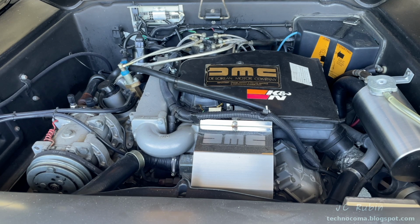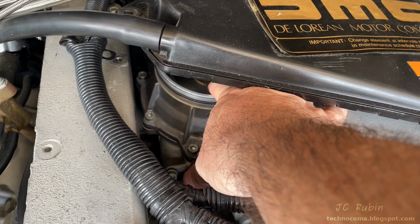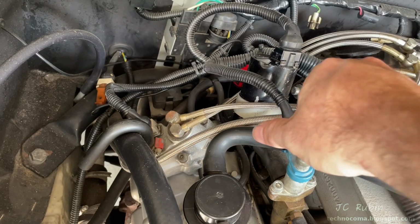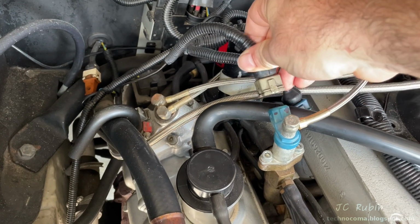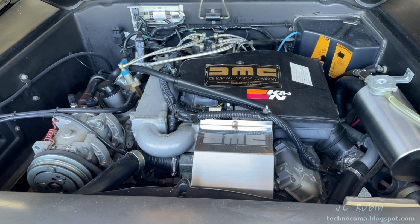Sometimes it'll buck, but it'll never run. In a pinch, I could depress the air metering plate slightly down under the air filter just to get a little gas in there to get it started. Or I could disconnect the gray cable on the control pressure regulator and plug it right in for a couple seconds just to give it a little bit of gas. But this isn't about how to get it started when it don't work. I want this to work properly.